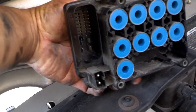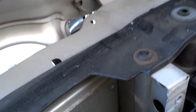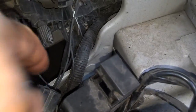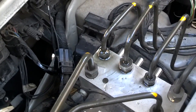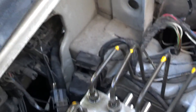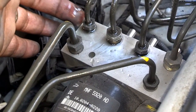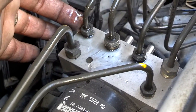As I was lifting the unit up, I realized there was another plug plugged into the bottom of it, so I had to unplug that. It's got two squeeze tabs — squeeze the top and the bottom and it releases. Once you get the unit out, you can reconnect these lines. You can actually drive the car with this unit out. Hand screw those connectors back in — this is an aluminum piece, it's real soft and easy to cross-thread. Don't do it. Hand screw them in, get them down as far as you can, then tighten them up.